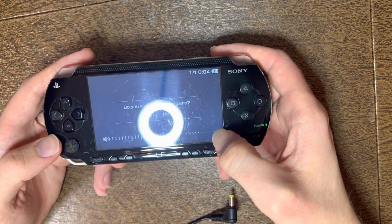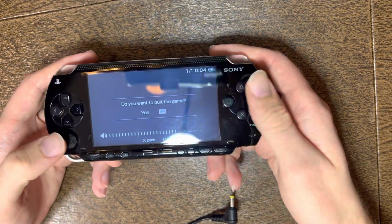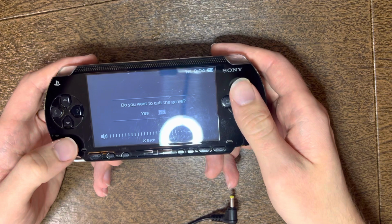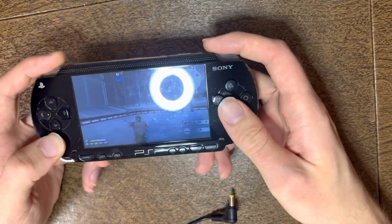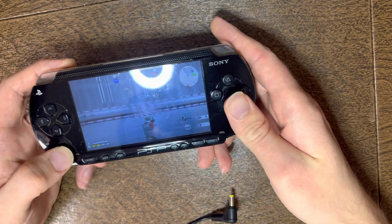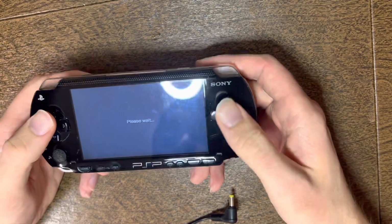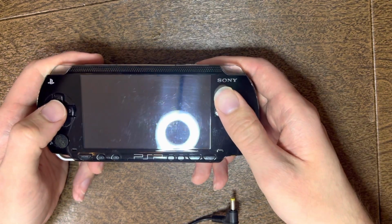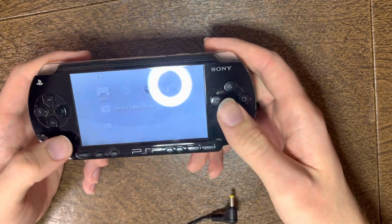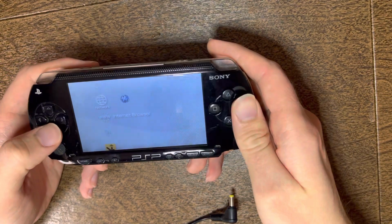for maximizing or capping out the volume that you can set it at, in which case you go over to the settings, go down to sound settings, and then turn that off. But once you've checked most of the buttons, this only takes maybe like 30 seconds or so. You exit the game. If you need to double check the joystick for sure, if you're unsure whether or not there might have been some lag or drifting, you can go to the internet browser.